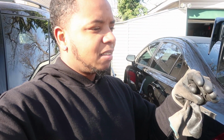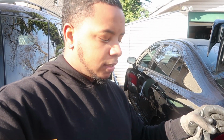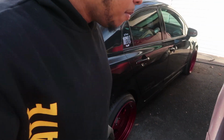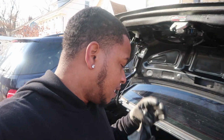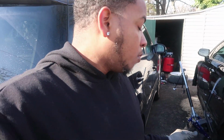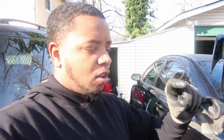But the rears, when you air down, it kind of sits a little bit on the tire. It doesn't go over the tire as much. I don't think it's gonna show on this side. But whatever, when it sits on the tire, it doesn't sit fender to lip how I want it. So with the upper control arms that I bought, all you have to do is just take that little bolt out, screw it all the way down, and then you can get more from that.